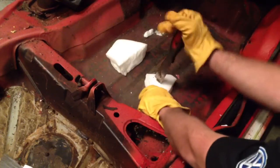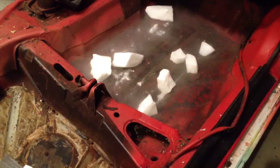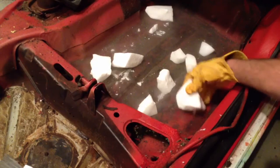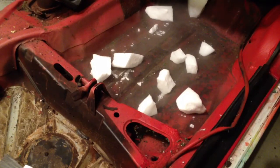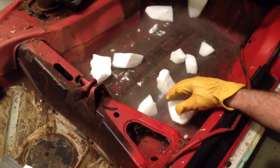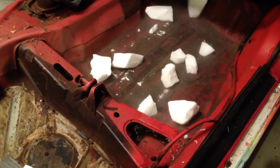I'll put my glasses on and break this up a little bit. Notice I've got these really thick leather gloves on — if you guys are going to be doing this, make sure you protect your hands and your face if you're breaking it up. I was wearing safety glasses this time. So I've got the dry ice on there. I'm going to let it sit for a few minutes, and what it's going to do is freeze the sound dampener and hopefully make it super easy to remove. I've seen people just whack this stuff with a hammer and it looks like it breaks right up, but we're about to find out.